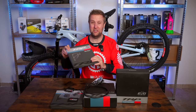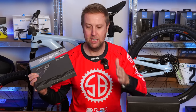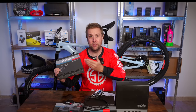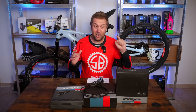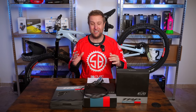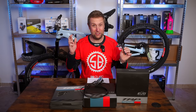These are TRP 203 rotors, and the interesting thing is they're 2.3 millimeters thick — a little bit thicker than other rotors on the market. I personally prefer to run the same rotors with the same brakes. I was originally going to go for MT7 Magura brakes and actually ordered a pair, but I've had a little bit of problems with the levers over the last couple of months — I don't think they're that strong, and bleeding them is a bit of a pain. I've heard really good things about bleeding and setting up these TRP brakes, so fingers crossed the setup goes well.